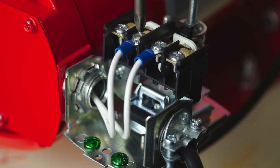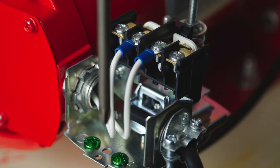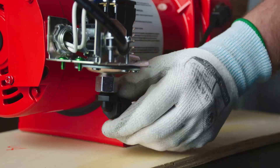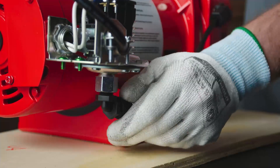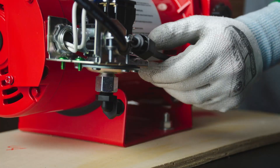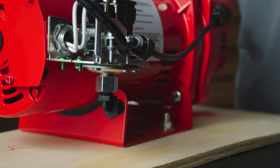Note the wire connection locations. Loosen the connection that is holding the pressure switch tube to the bottom of the pressure switch and pull the tube from the connection. There may be a small amount of water that drains from the tube — this is normal.